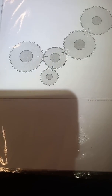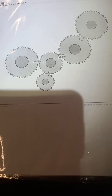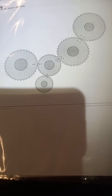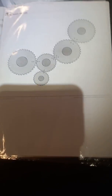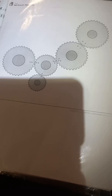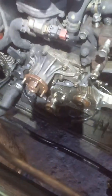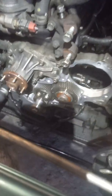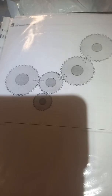That's the timing on the 3-litre Isuzu D-Max, 4JH1 engine, 3-litre diesel, TFS 77 chassis model. Once it's timed, you can reassemble everything, put the covers back on, and the marks on the outer covers will then line up. Hope that's useful to somebody — it looks more daunting than it actually is, but it's pretty simple.